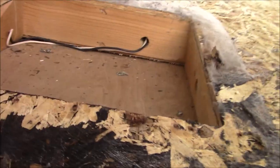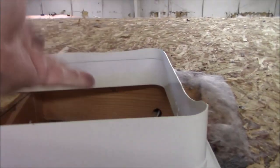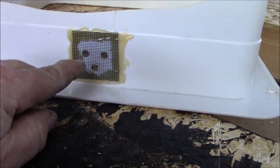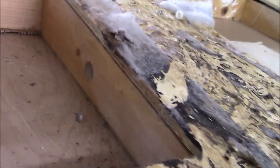We are going to re-deck this roof — that's what we're gonna do. Look at all this damage on here. Very peculiar why we got all this damage here. This goes up inside the ceiling, right? The fan is in here, and the fan draws all the moisture from the shower right here. It draws all that moisture up — and where's it shooting it out? These holes. I don't know who did this or why, but that is just not smart. Almost looks like it may be factory — if they thought it was gonna vent somewhere, where's it gonna vent? They got a couple holes here and there, but that's not smart at all.